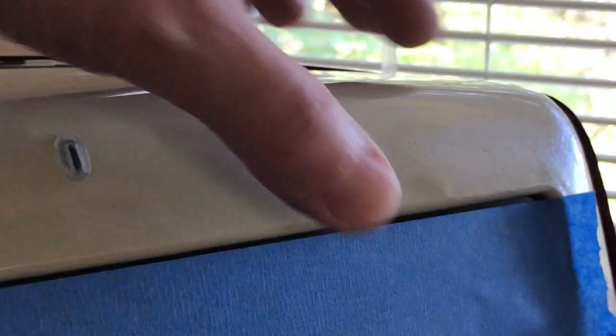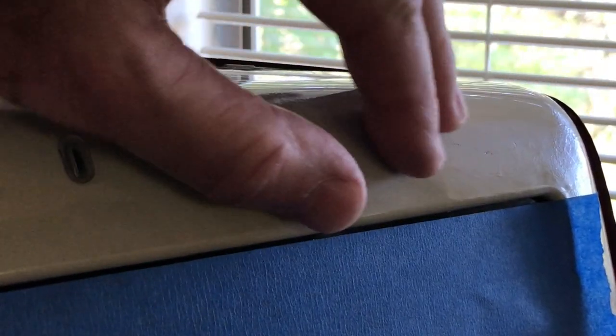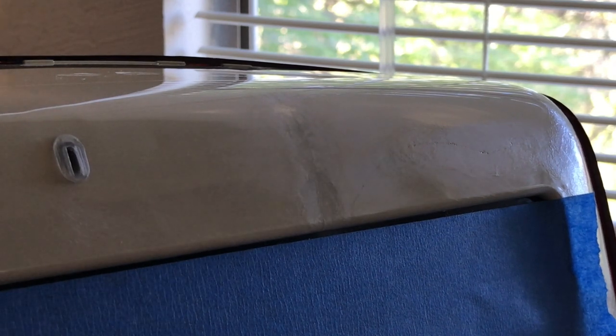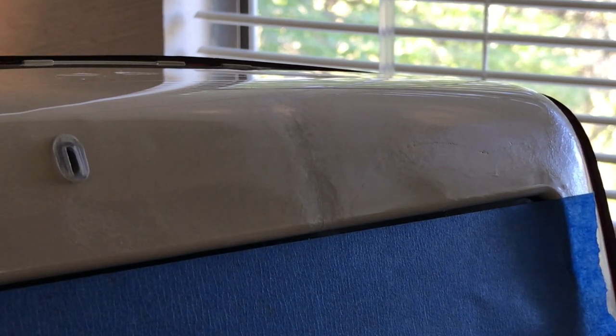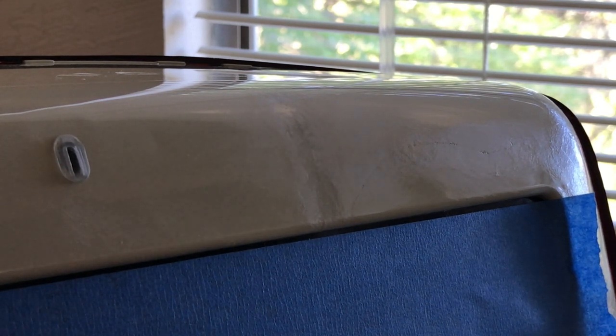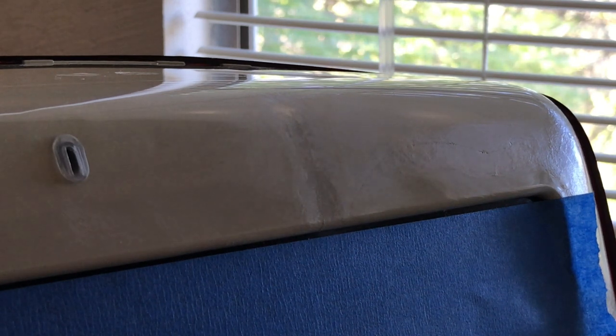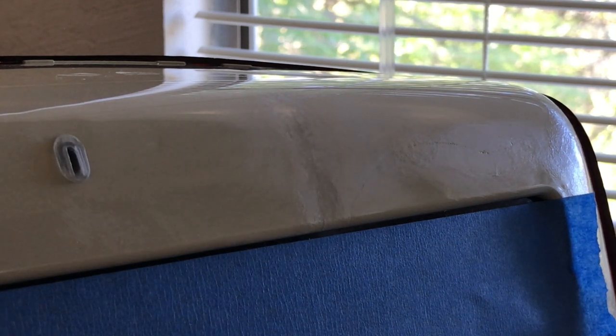It's a labor of love — it takes time. You're not going to do it in a couple minutes. When I polish out those older Mac cases, it usually takes me a couple days to totally refurbish a case, and it looks brand new — I get all the yellowing off. A lot of that yellowing is caused by the injection mold process: the chemicals they use to keep the plastic from catching fire, since it's extruded at such high heat. That stuff leaches out over time and reacts to the environment. Ultraviolet definitely affects it, and you get UV from many, many sources.